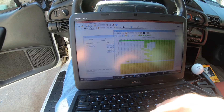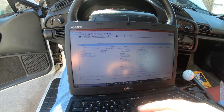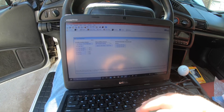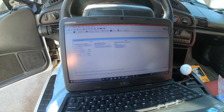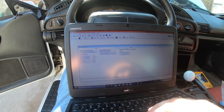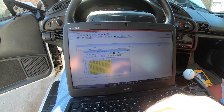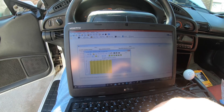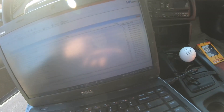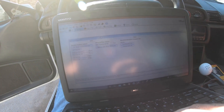Anything above 105 kPa is gonna be boost, so 110 and up is boost. I'll go ahead and save that — got all the injector settings ready, set to 65 (I put 64, which is fine). In HP Tuners, go to Engine Diagnostics on a two-bar setup. You want to fail your mass air flow sensor — set it to one hertz. Then max out that table so it can actually go into boost; I put 250 on it. Then go to DTCs and uncheck the MAF codes — 101, 102, 103 — and set MIL on first error on the high circuit so it defaults to the MAP sensor.